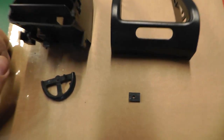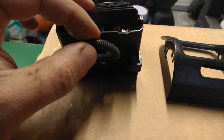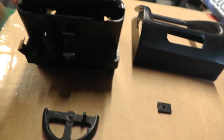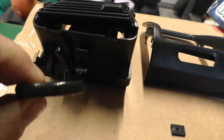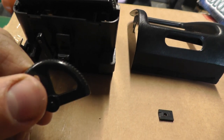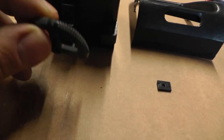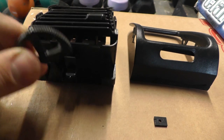I'm going to try and have a go at fixing this with some nuts and bolts. It's got this pivot down here — this is the thing that moves right and left — and I'm going to drill through that and place a little nut there. This used to have a peg fused to it, but no longer, so I'll drill through that and attach a little screw. It's all plastic but you won't see any of those screws. I don't have to buy another one because it's a bit expensive.